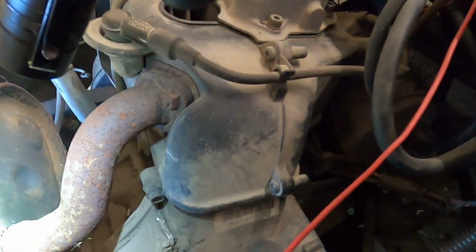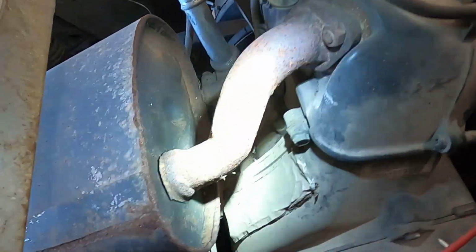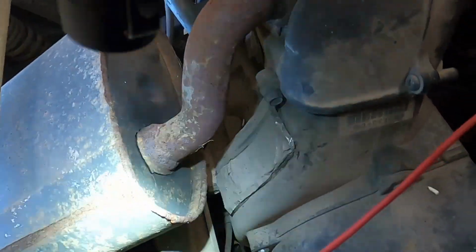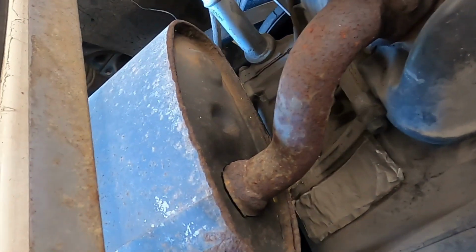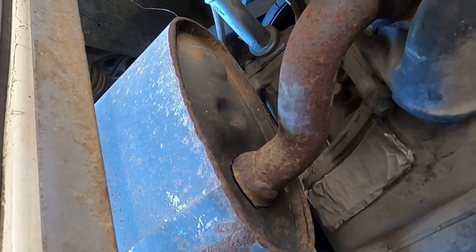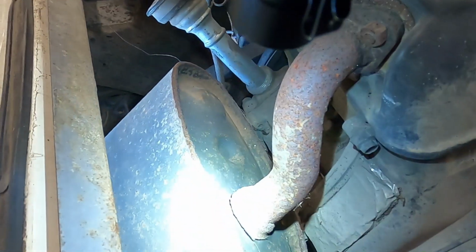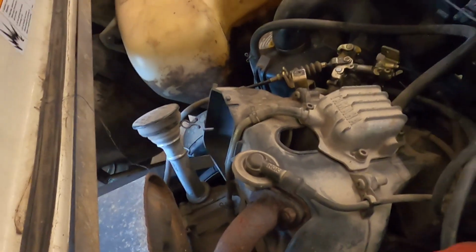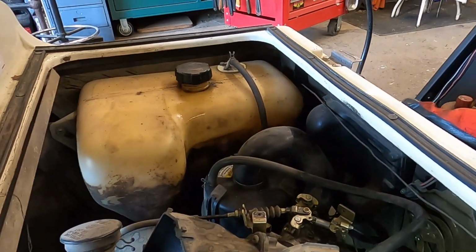And then I did notice something else here. You guys see that? Yeah, that muffler is just slightly cracked away from the manifold. So may have to see what we can do about squaring that away too. To get that welder turned down low enough, we might be able to patch it. Looks like it's been patched once before, but we'll attempt it again. And as far as everything else goes, even the reverse beep works, which is annoying.